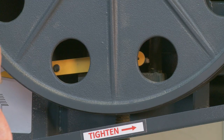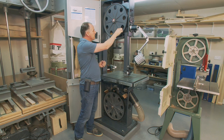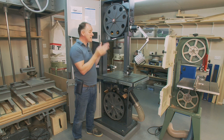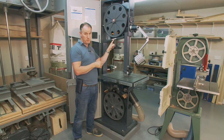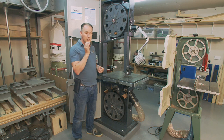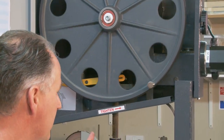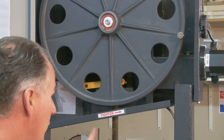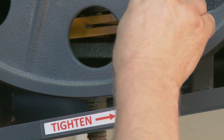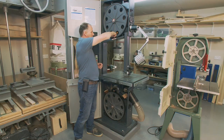I'm going to artificially put some weight on my wheel, spin it by hand, and what we're looking for is for it to consistently come down so the heaviest part is at the bottom of the wheel. I'd want to check this four, five, six, seven, eight, nine times. Every time it comes down to the heaviest part — this looks encouraging, it's rocking — but it should come down to where the weights are at the bottom. I would put a chalk mark on where that heaviest spot is.